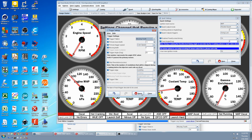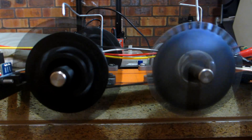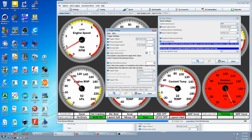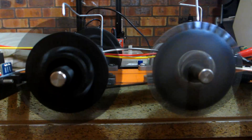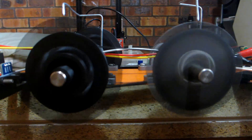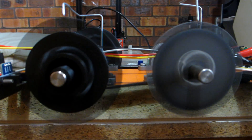Burn that. We go back to Tuner Studio and make sure we are in waste spark mode, which is correct. We go back to our rig and check the result. Top dead center on the crank is correct. Compression top dead center on the cam and overlap top dead center. Missing wheel cam in waste spark running correctly.